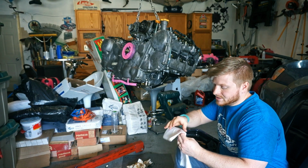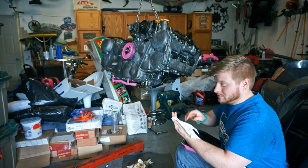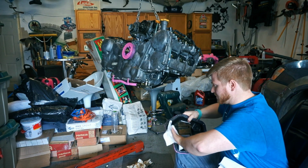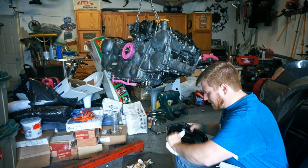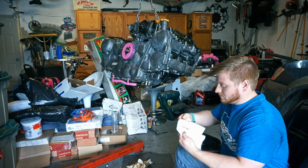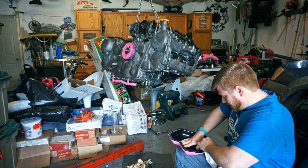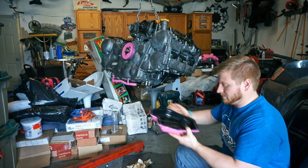I do have an RTV episode up showing you the best ways to remove RTV. Basically, I won't tell you, but I do have one caveat to that. The roll-lock disc on steel works fantastic. In that episode, I was only working on getting RTV off of aluminum, and the roll-lock disc didn't work too well on aluminum, but it works a whole heck of a lot better on steel, because you can jam it on pretty hard, and you don't really have to worry too much about it scratching up the surface of the steel. With the least abrasive disc, so the white one, perfectly degreasing the surfaces. I did go ahead and take this one inside as well and wash it off and scrub it down with a brass brush.